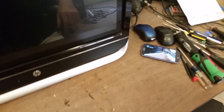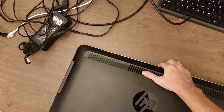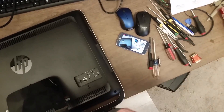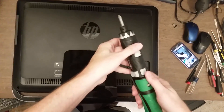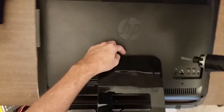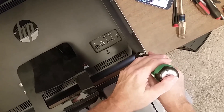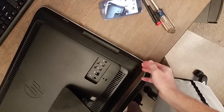So I powered it down and got into it. I'll go ahead and take it back apart. Each all-in-one desktop computer will come apart differently. This one was one of the easier ones I've come across — really just three screws holding it together and the entire back comes off. The screws are captive; they don't actually come out on this computer. They just stay with the back. It's a very nice design.